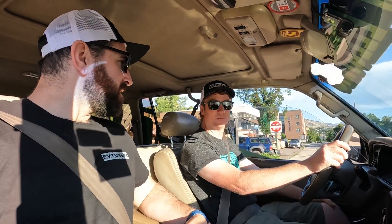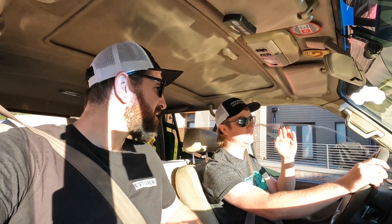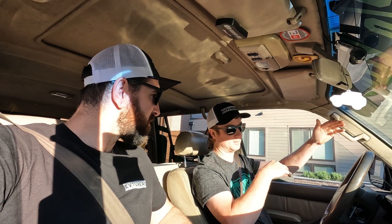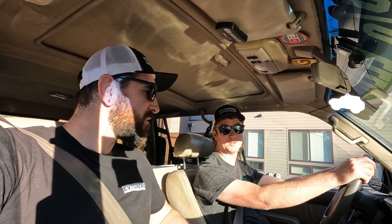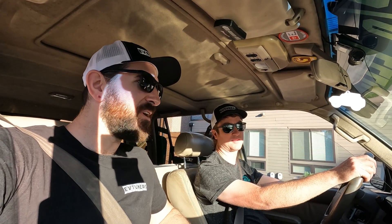Recovering from 18% to 30% going down a mountain shows that elevation change is a huge factor in range planning. You don't just think about distance — you need to know whether you'll be higher or lower at the end of the trip. If you can make it to the top of a mountain, you can usually make it back down again.